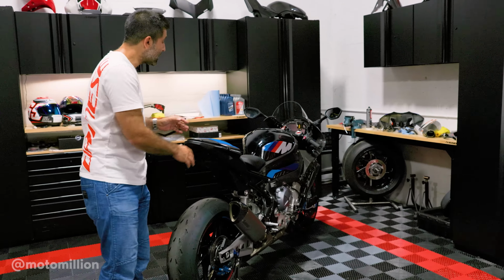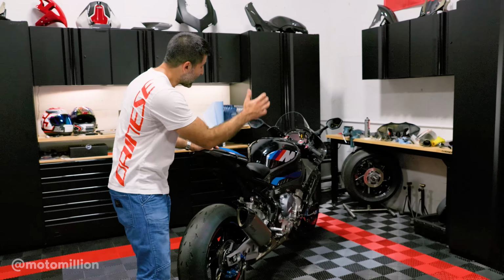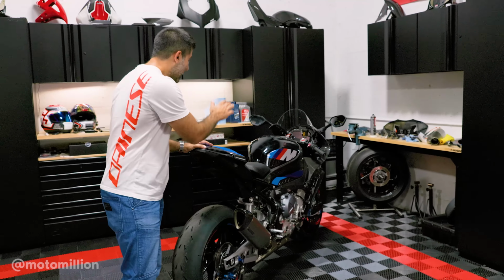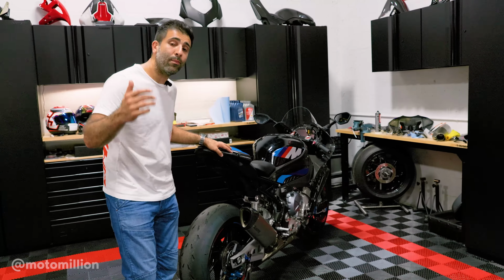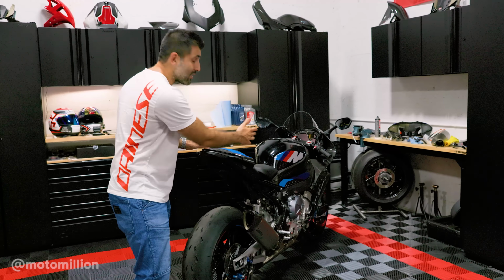But let's get back to this, and let me tell you guys why. When I told you guys in the beginning of this video that I prepped this bike to get running on the dyno, I took the side panels off. And this is on the new bikes, guys. So it's on the K67 and K66 S1000RR and M1000RRs. On the older bikes, I don't know exactly where to pick up the RPM lead, but I know in this case, we have to take the right side panel off.